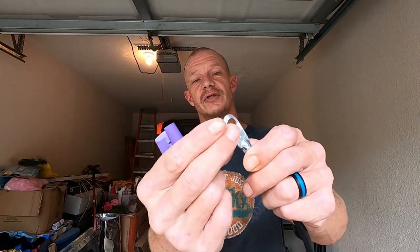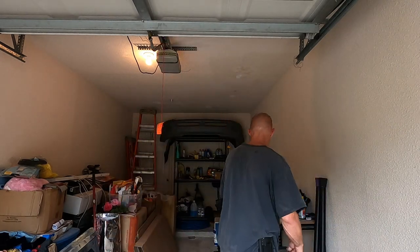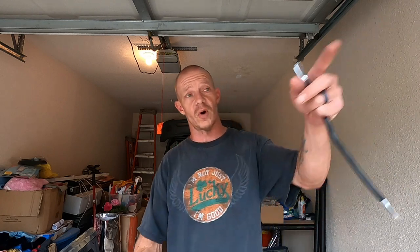Just like when you buy a new battery and you clean the terminals before you hook it up — I got some 180-grit sandpaper and cleaned the ends. I want a nice raw surface for everything to mate to. I rolled it up nice and tight to fit it in there, and did a little reaming on that too just to get a clean, raw surface to mount to. I want to clean the mounting surface on the fender and clean up that washer between the bolt and the cable.